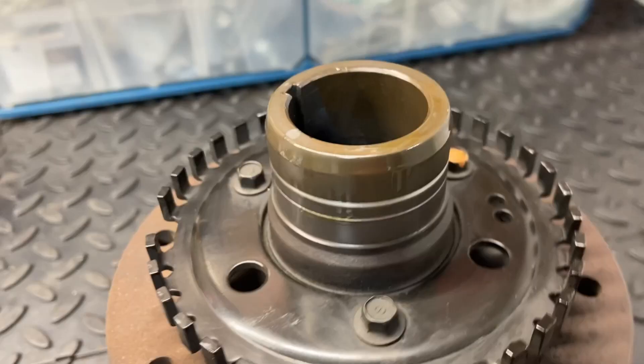Hello and welcome back to Matt's Automotive channel. As you may recall, in one of our previous videos we addressed a leak from the front crank seal on this car. What we found were some grooves that had been dug into the balancer, so we tried pushing in the new crankshaft seals in a slightly different location so the seal didn't line up with the grooves. We still have a little bit of a leak, so today we're going to pull the harmonic balancer back off and put on a seal sleeve over the end of the balancer.